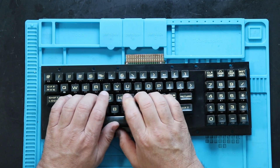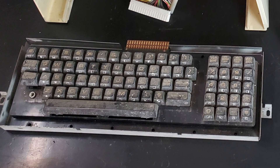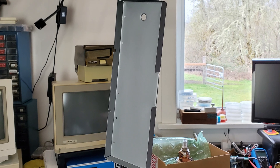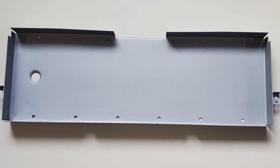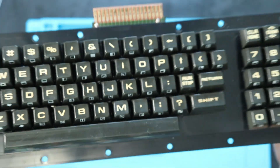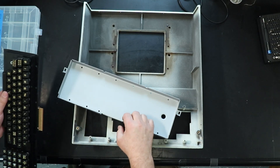The metal frame that holds the keyboard to the main body has some rusty spots and looks generally pretty shabby. This got sanded and treated with the rust converter before I repainted it with a high-zinc paint. This looks much better, and the high-zinc content should maintain electrical conductivity. I'm totally thrilled how this keyboard came out! So once I get that final missing shift key, this keyboard will be complete. I thought it was going to be a crusty mess — this thing looks awesome!